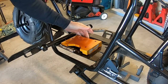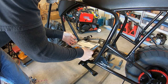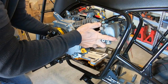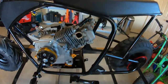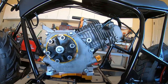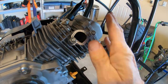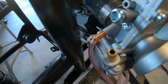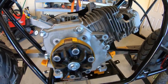I think I'll set the plate about right here and then stack this one on it. We'll set the engine on here to mock it up. So that way you get a little rise out of it — like a seven degree, but not too much. I think I'll be able to get an exhaust on here to snake around and come through the frame. I want to do it through the frame instead of outside. The carb definitely clears — you even have a little bit of room there between the frame and the carb.